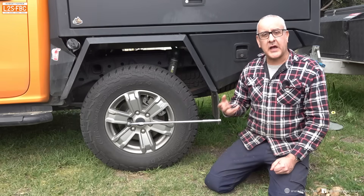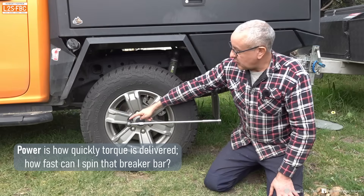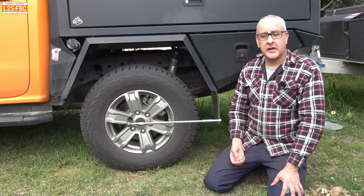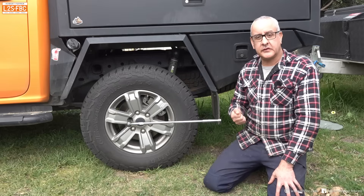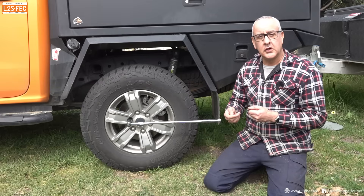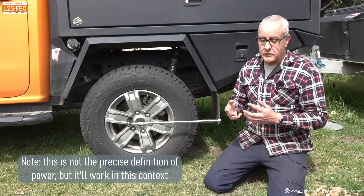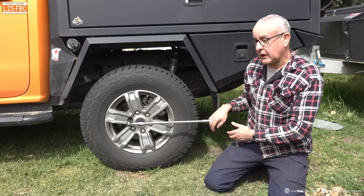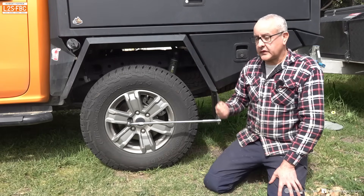Well the answer to that is power — how quickly could I spin this? If I put my entire weight on it, how many revolutions per minute could I do of this wheel nut? The answer is not many — probably one every 10 seconds. Now if we consider the engine in this vehicle capable of producing 600 Newton meters, it can do that at maybe 2,000 to 3,000 RPM. So power is how quickly torque is applied, and that's why car engines are able to do work much quicker than humans — even though we might apply the same force using a long enough lever, we can't apply that torque as quickly, i.e., power, as the car engine can.